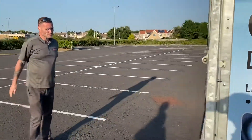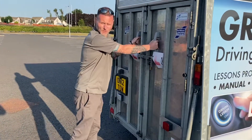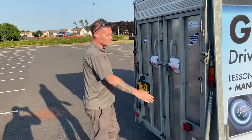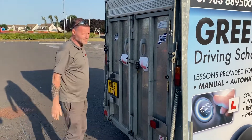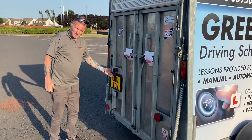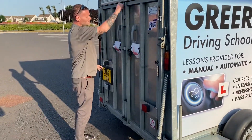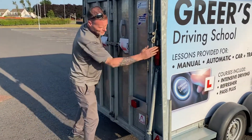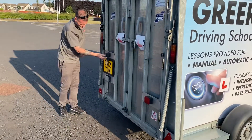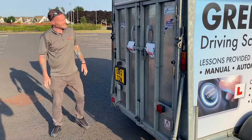Coming to the back of the trailer — he doesn't want a full MOT, just to know the doors are shut. Demonstrate that by giving them a pull. This is a three-way door that comes to a ramp at the back and bifold doors. Check the split pins are in so the hinges are secure as the doors fall down. The number plate must match the towing vehicle — it's removable for security at night. Check all door locks are shut, all lights are intact, lenses are there, reflectors are there, fog light, number plate light, reversing light, reflectors, and springs — all present and in good condition.